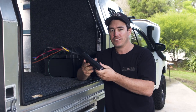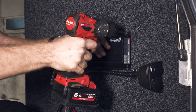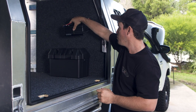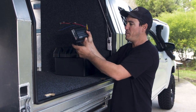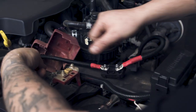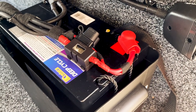The charger needs to go right near your second battery. The reason is voltage drop — if the charger is a long way from the second battery, all that power it outputs will be less by the time it gets to the battery, meaning it won't charge as fast. By putting it close to the second battery, you ensure there's no voltage drop and your battery will charge as fast as possible. We're going to mount this one on a panel very close to the second battery, which is inside the canopy. The other thing to consider is where you're going to mount your fuses. The battery charger going in the canopy is going to be charged from your alternator and start battery, so you'll need a midi fuse in the engine bay as close to the power source as possible. You'll also need a fuse between your charger and the second battery, and fuses on whatever you use the secondary battery to charge — like a fridge or camp lights. So essentially you'll need three lines of fuses before you can run something like a fridge.